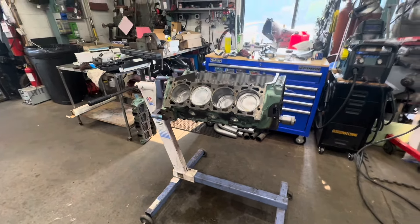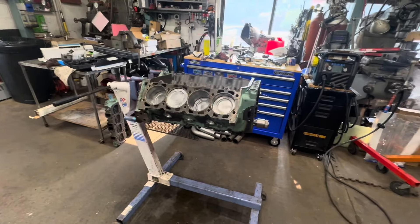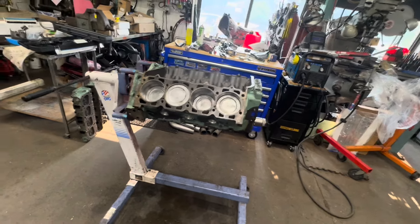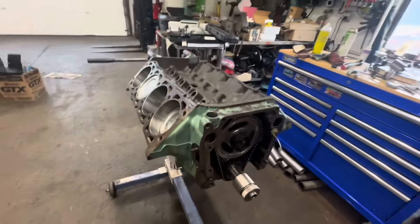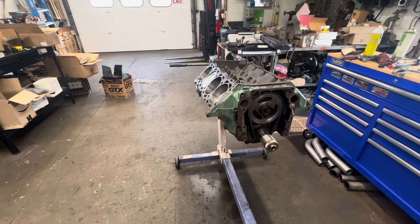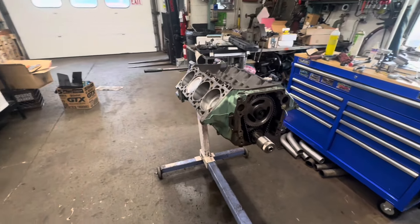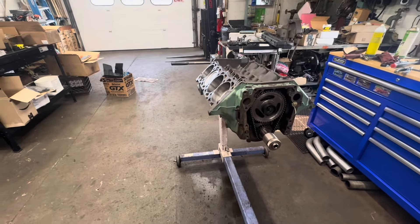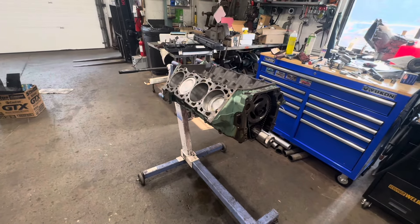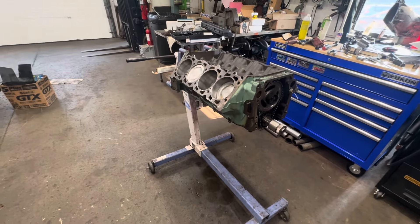This kid bought it because he wanted to buy a Trans Am and have a motor for it, and he never did anything with it. So I'm putting a cam in it. I have a W34 cam, which is from a '70 Toronado GT, but it's also the same cam any '74 442 automatic would have, or a '69 Cutlass. It's nothing radical. It's small — should idle good and make tons of power.